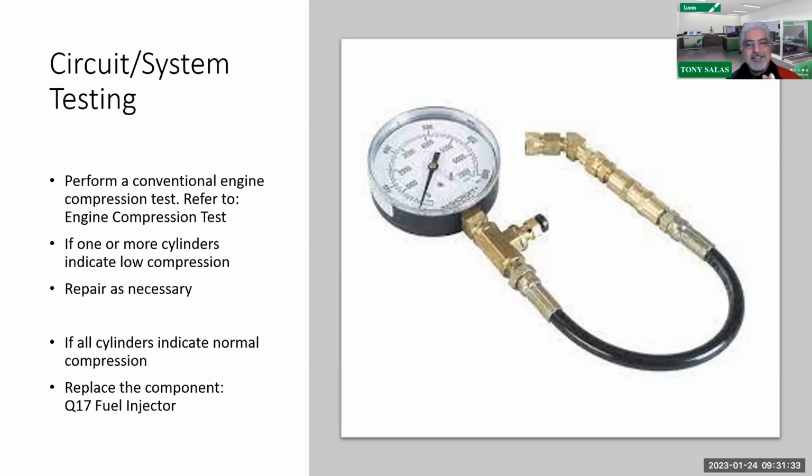So please note as I go, this is funny because I bet you this is going to happen, because not many are adjusting the valves when asked for by Duramax, which is what, every 70,000 miles. Severe, do it every 50,000. So in this case, it isn't surprising I get a Duramax coming in, whatever year it is, and what I hear, tick, tick, tick, tick, tick, and it's not the injectors, it's what? Excessive valve lash, and it requires valve adjustment, okay?